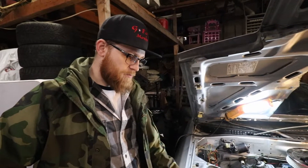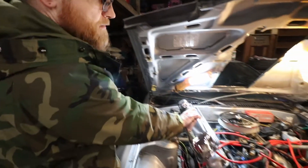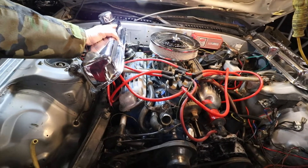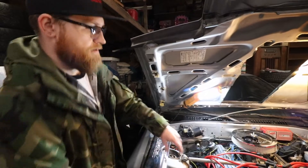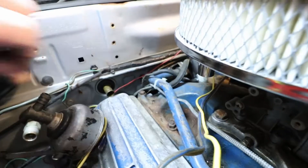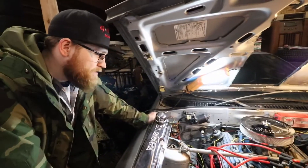When you put these big motors in these cars, the bodies can actually twist around and you can completely ruin the frame of a drag car - then it'll just drive to the right or left forever and it'll be garbage. You always want to add a lot of support. One other thing you can do is put in a roll cage inside - that stiffens the body as well and helps with suspension and overall handling.